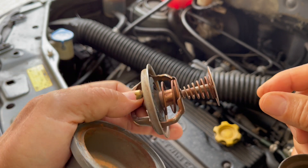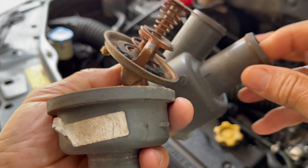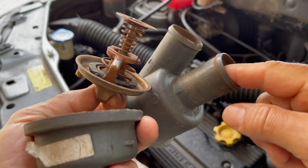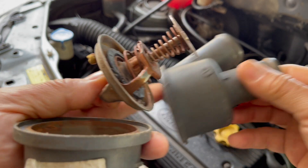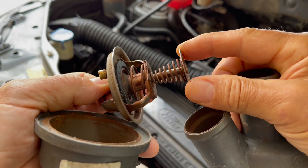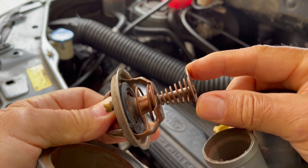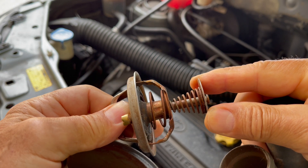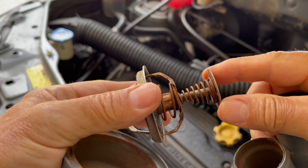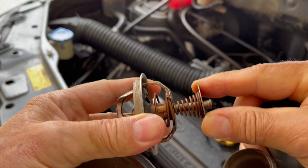It's called a PRT which stands for Pressure Release Thermostat, because this plate and this hole — which goes off to the engine water outlet where the hot water from the engine comes from — tries to go down here, and if there's a lot of pressure it'll push against this plate and open up, hence the name pressure release. It possibly serves two purposes: it relieves pressure on the water pump, so if your engine is at high revs the water pump allows more water to flow through.